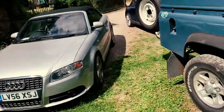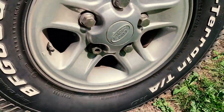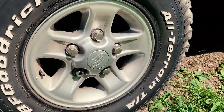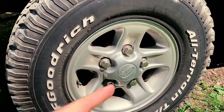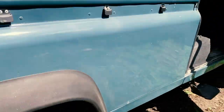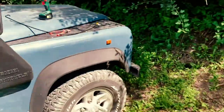Unfortunately the oil was leaking out from the axle all the way down the wheels and then spraying out and up all over the car, going everywhere on both sides. What I found out was that the breather was missing, so the pressure was building up and coming out of the seals at the end of the axle - actually very old and perished, and one was missing.